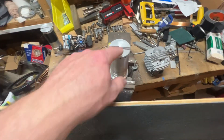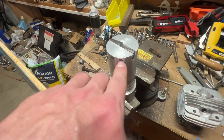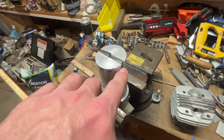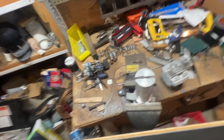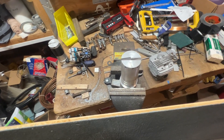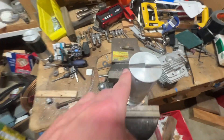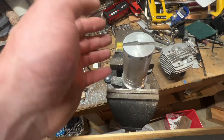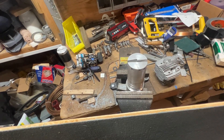Let me show you quickly this mandrel I used to cut the chamber — a 56 millimeter mandrel. The front two set screws hold the cutter in place and lock it in. This third one controls the height — these are all quarter-20. That angle finder is actually for doing alignment on cars — I'm just using it as an angle finder, and I'd assume it's pretty accurate. The cutter edge is slightly past the edge of the mandrel so you get that full cylinder, full chamber width cut with no clearance issues.